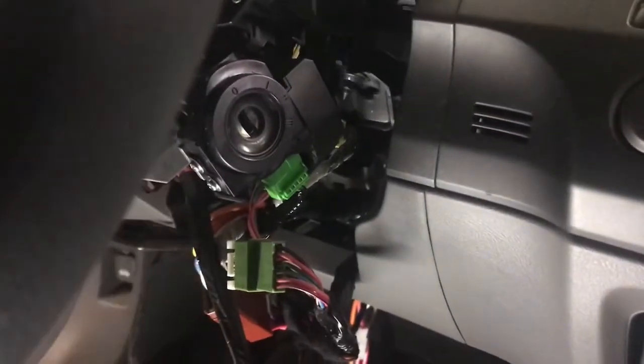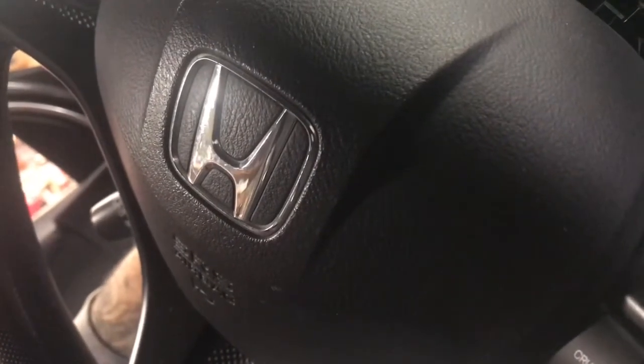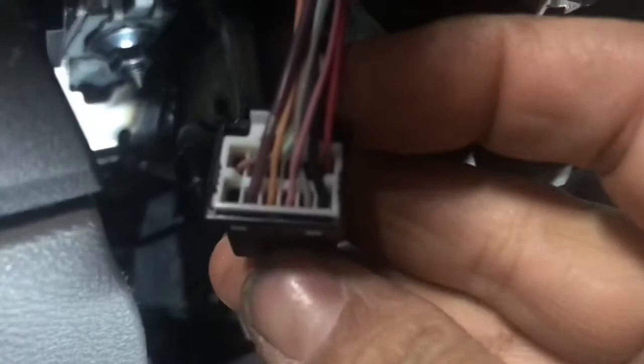The only other connection is your parking lights, if you want your parking lights to turn on. Release the plug. Depending on whether you have auto lights or not, the parking light wire is connected to pin 8, which is the gray wire. If you have auto lights, you're going to connect your blue-white wire with the black dot on the orange wire for lights-off.